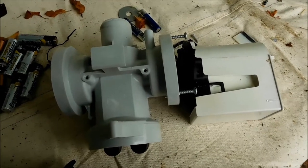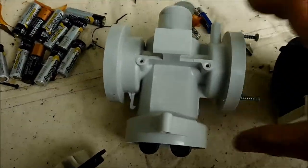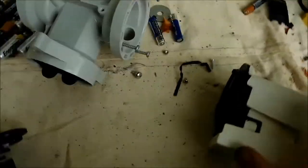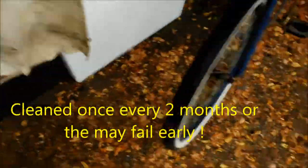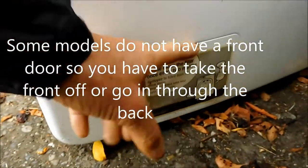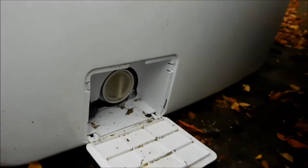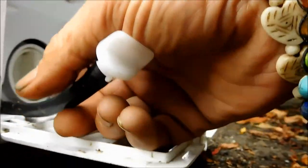This is your typical water pump on your Kenmore Whirlpool front load washers. If you take it out and take it apart — take the motor from the pump housing — these pumps should be cleaned out through this front access port. On this Samsung here, this access port is down here. That's typically where the Whirlpools are. You'll see there's a little drain tube here and the access unscrews here. It should be drained from here. If it's plugged up you could tip it up so you don't have much coming out, then stick a mop under and pull it, and then open up this cap here.